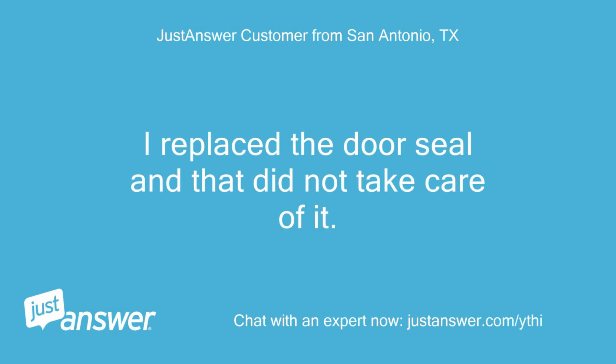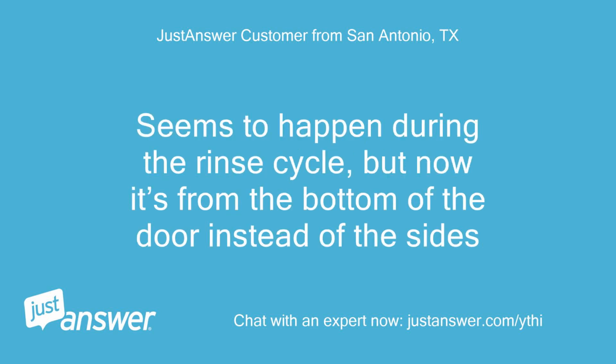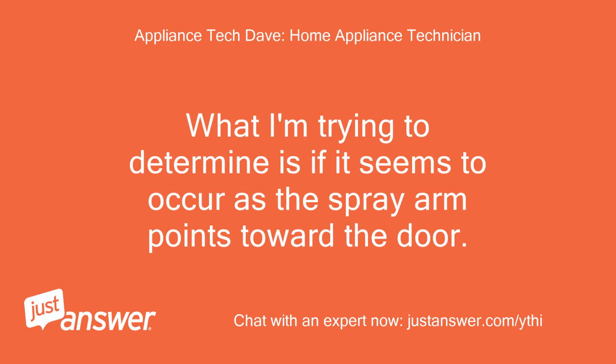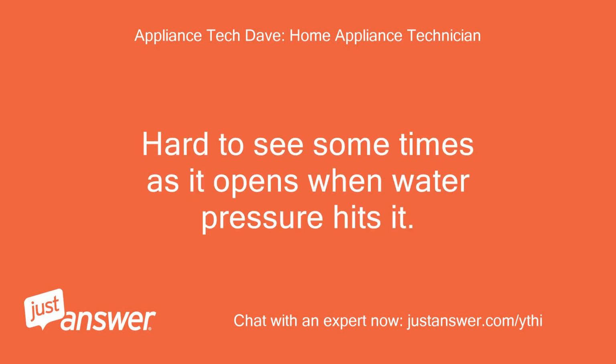I replaced the door seal and that did not take care of it. Then we tightened the screws on the inside of the door and it still leaks. Seems to happen during the rinse cycle, but now it's from the bottom of the door instead of the sides. Does the leak happen on one side and then right away on the other? What I'm trying to determine is if it seems to occur as the spray arm points toward the door. There may be a split in the plastic spray arm. Hard to see sometimes as it opens when water pressure hits it.